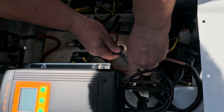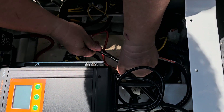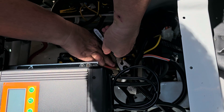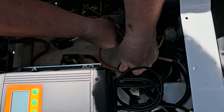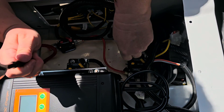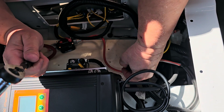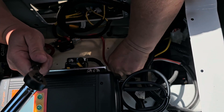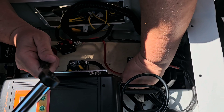I've got my circuit breaker connection on the house battery, so I can go ahead and tighten this up. I'm working on this system hot, just because I'm being careful — but you definitely want to disconnect the house battery and the chassis battery so you don't have to worry that your wrench could touch anything metal. Because if you touch anything metal while you're on a wire that has voltage, you're going to short out and have more problems to fix than you started with. Always disconnect all the power to anything that you're working on, or you will be sorry.